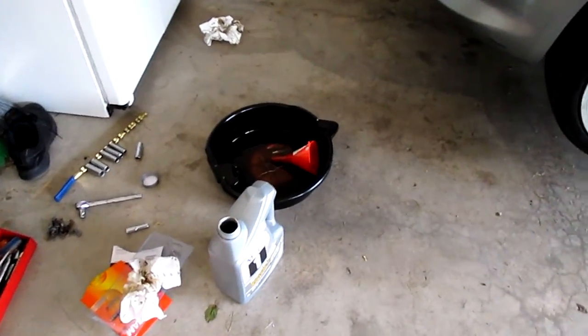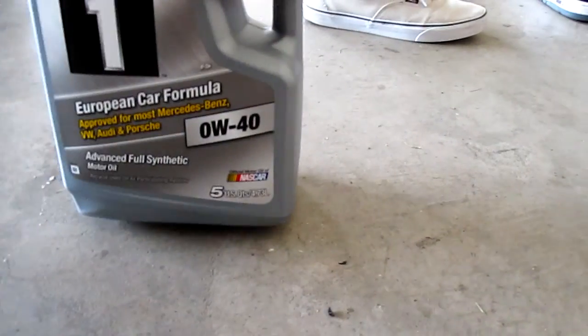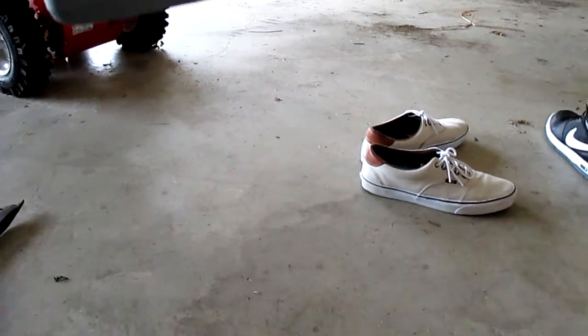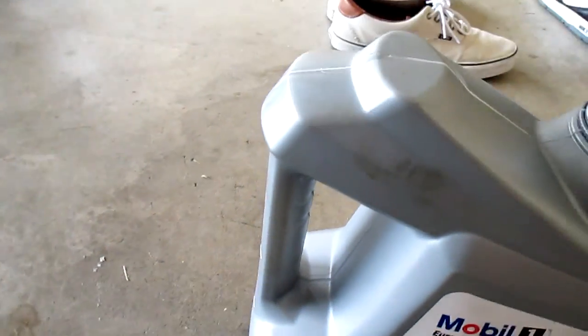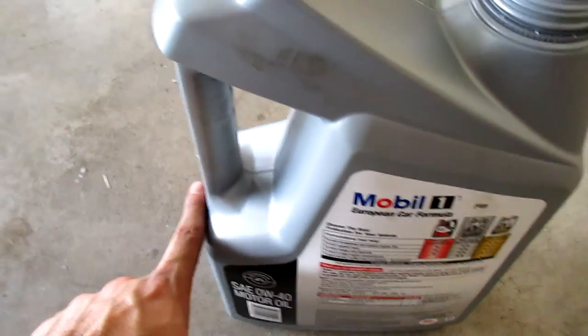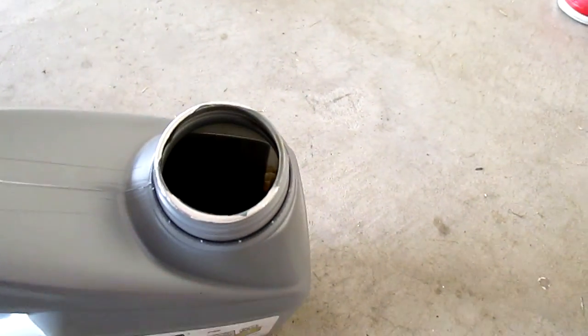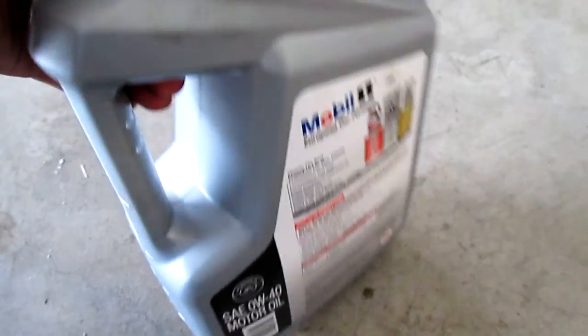Here's a little extra bit — I just poured all the oil back out and look in there: it's not even halfway full. I just put five quarts in and dumped it all out, and I only got about that much back. I do have an oil leak, but this seems like more than a leak. I think I might actually be burning oil. Well, that sucks.